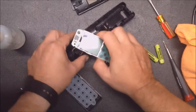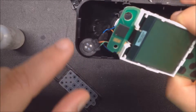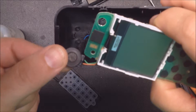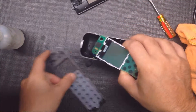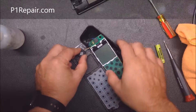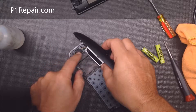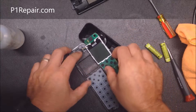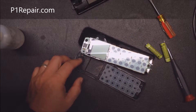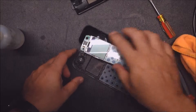And that's pretty much it. Now we got to put the speaker back in. That's the back of the speaker — the four dots — and that's the actual part that makes the sound. So we want the four dots to be facing up, and it slides in sideways. There's space for this little notch in the wires; it kind of tucks down in there good. If you've got any fingerprints on the display, you're going to want to clean that off now, or any dust on the glass.